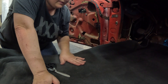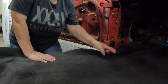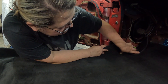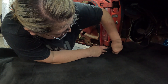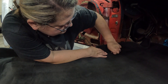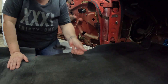Now that the carpet is in, I'm pulling it down to where he wants the trim to lay, just trimming it up. This carpet here we're going to go around this edge because that kick panel lays right down on that. Maybe cut out just a little bit up there for the headlight dimmer switch. Keep it close to the wall because we got that kick panel, but it's going to be fastened to the wall - it shouldn't come way out in the floor.